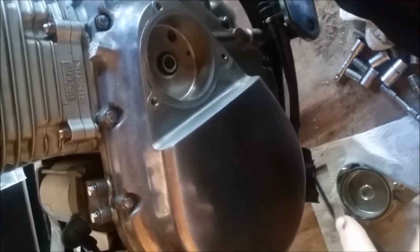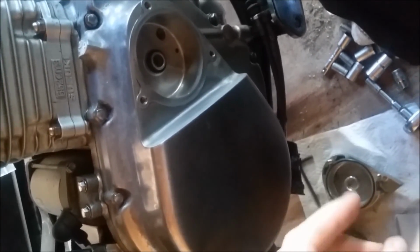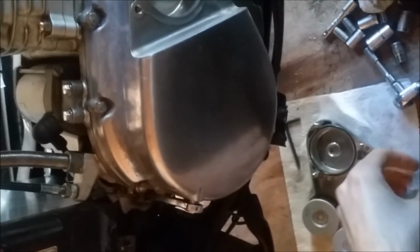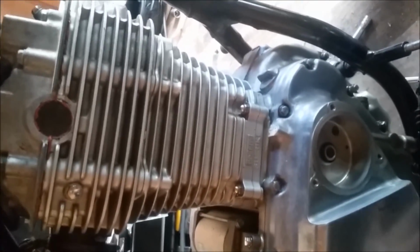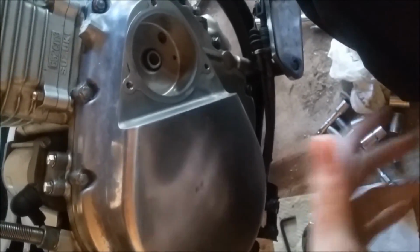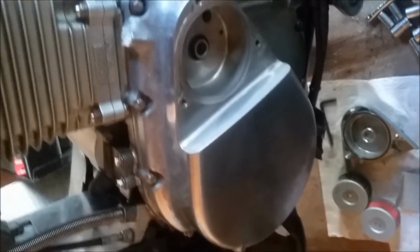With most bikes, even with the filter change, unless the engine was taken apart, the oil capacity is 2.5 quarts, or I think that's like 2.7 liters or something like that. You don't want to put that full amount in generally because remember, your engine's been running. Even if you run it for a little bit, which you also should when you do the oil change, you should run it for a while. Shut your bike off, let it cool down a little bit, and then open your drain plug up when you drain it, because hot or warm oil will come out of the engine much easier than oil that's cold and thick and sludgy.